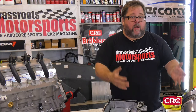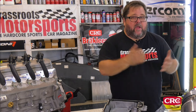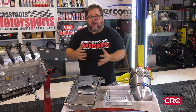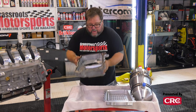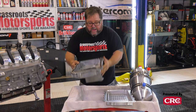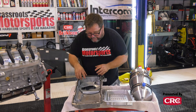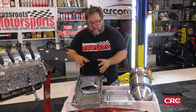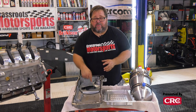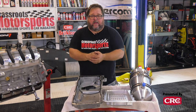Here's the knock. Modern car, especially a good handling car like a Corvette, you put a sticky tire on it. You put a BF Goodrich R1S like we're using, or a Hoosier, or even a hot street tire. Something where you're producing a lot of lateral grip, and you're essentially leaning this oil pan over sideways. If you're pulling 1G, it's like this oil pan is sitting sideways, and all of that oil is gonna climb up the side of the sump. Whatever's left in there climbs away from the oil pickup down in this sump. That pickup's gonna dry out, it's gonna starve for oil,